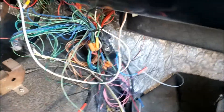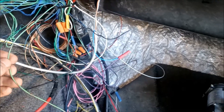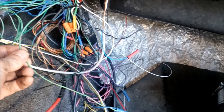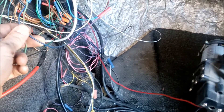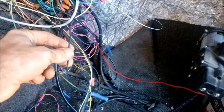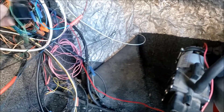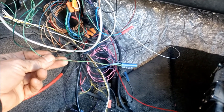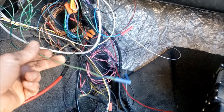Inside the car — I know it's a mess. It ended up like this while I was trying to figure out where my extra PWM output went to tie all this together. Once I'm happy with the setup I'll shove it all back under the dash and button it up. This blue wire runs the ground side of the old fuel pump relay. I was originally going to use the boost output to drive the fuel pump, but the problem was that in firmware version 1.4 you cannot assign an output and still keep the old fuel pump output working.